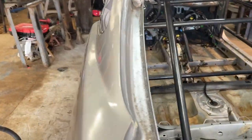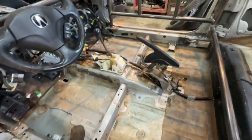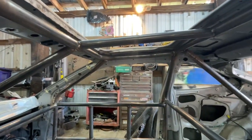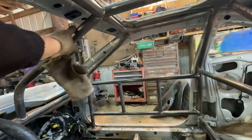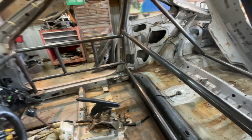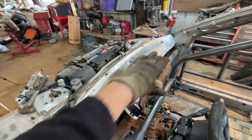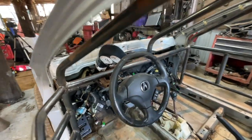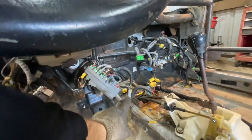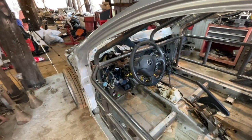Look how clean it is — that was like a five-million-hour time-lapse. Austin hates the long stuff, but you can see the inside is completely cleaned out and 100% welded out. I got the upper bars done. Had to do some modifications and trim those pieces, which is normal for a Dickinson cage — you have to trim them because of how far back and forward you set that. Dad is going to do one more little bit of touch-up on that back B-pillar post for the main hoop. While he's doing that, I'm about to come in here and take all of this wiring harness out so I can tuck it real nice like we did on the eight-car — get rid of things, zip-tie things up that don't need to be in there. The airbag system and stuff is coming out, and all these wires are getting moved up so there won't be any wires down here. We'll come back when we're done and show you guys how it looks.